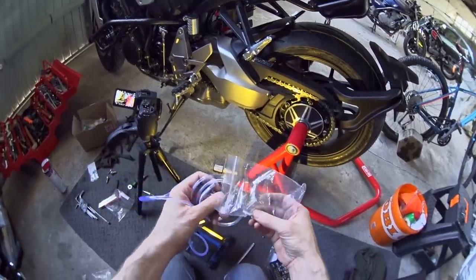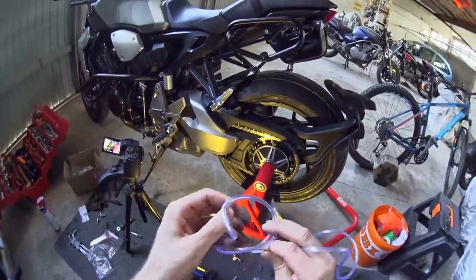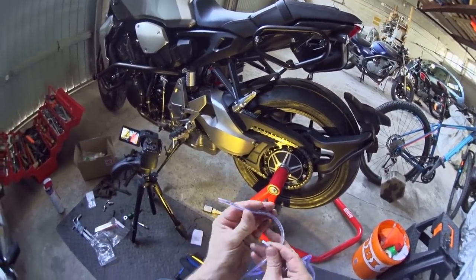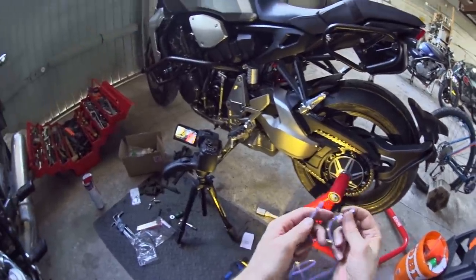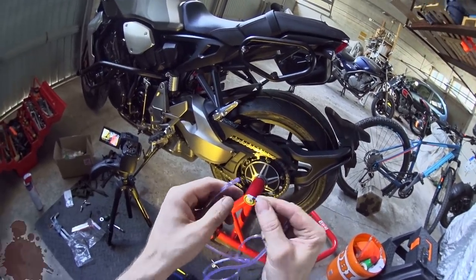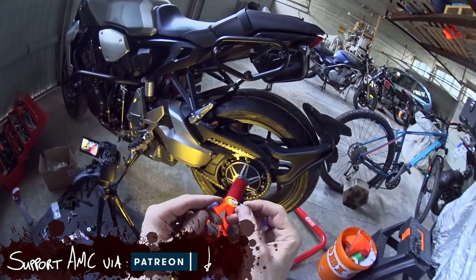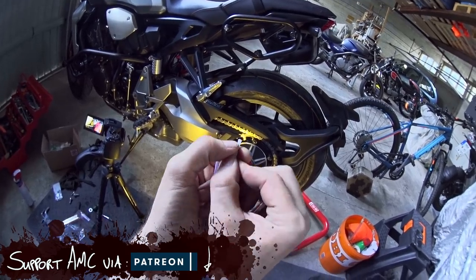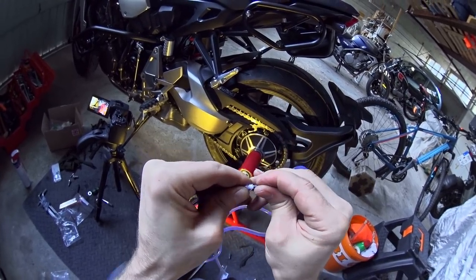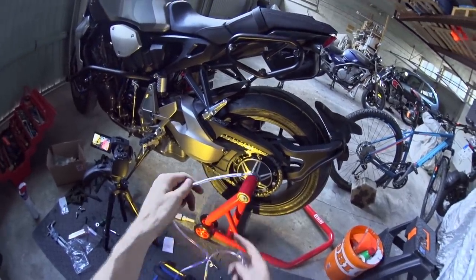Moving to the rear end — we'll unpack our hose piece. In this pack we have obviously a piece of hose; one end has a piece of metal in it so you can bend it into shape and define exactly where the oiler is going to feed onto the chain. Also in here is the actual application nozzle. Before we can go further we need to stuff this into the hose — there's a little piece of black tape around the end to show you that's the end with a barb on it, and this needs to go into the hose so it locks itself into place. Quite tight, but we poke that in up to the black bit and that's now in the hose and ready to be mounted.